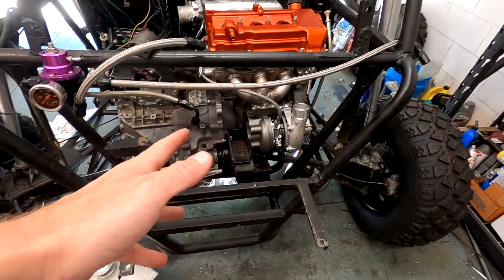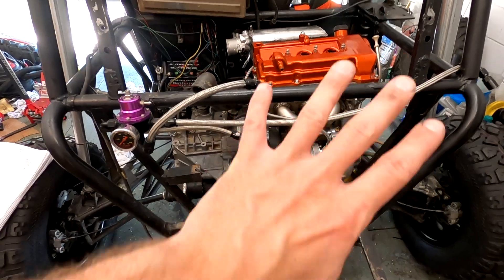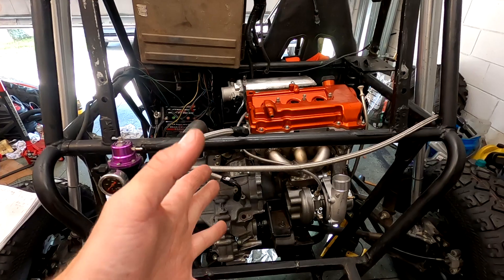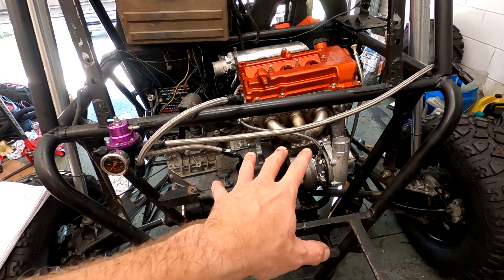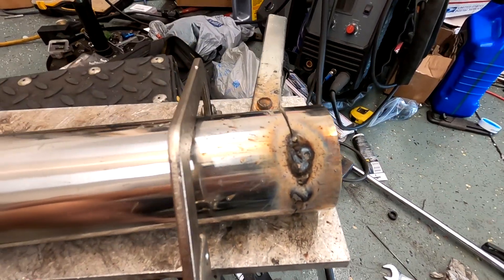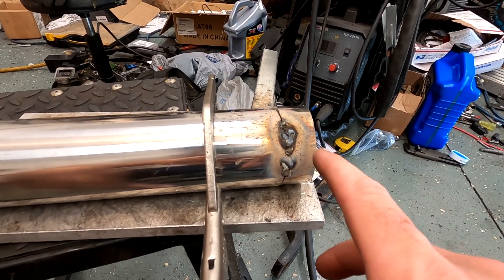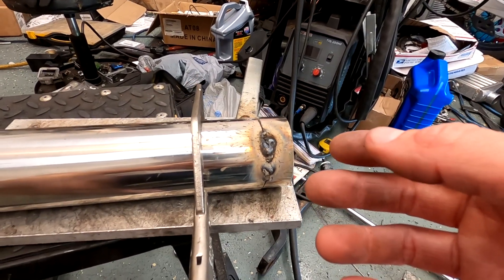We'll finally get this engine installed. Today is Saturday - I leave early on Thursday for Durham town. I realized I thought I had everything I needed, but the only problem is I'm out of Argon. Because it's a three-day weekend, I won't have Argon until Tuesday, which means I wouldn't even be able to begin fabricating the exhaust until Tuesday. I've got a pretty strong weld going here and this was done with the flux core. I know I shouldn't do it, but this is all stainless steel exhaust. I'm going to use this flux core with the stainless steel - it's the only way to keep this project moving forward.